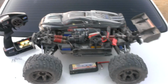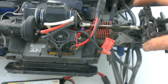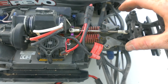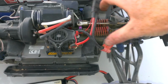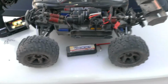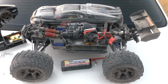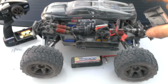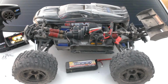My point is, you don't want your suspension so stiff that the car doesn't smack the ground off of a big jump, because then all that initial shock is right here in the back. Okay? Now, when the car does slap the ground a little bit, it distributes that shock through the whole chassis. And that's how you cause blowouts, is having those so tight. That'll cause your shocks to blow out.